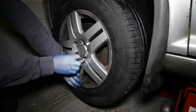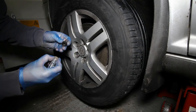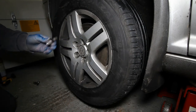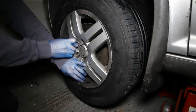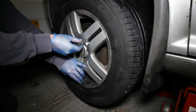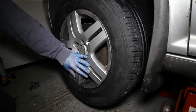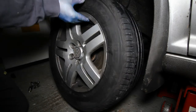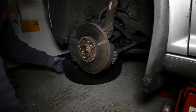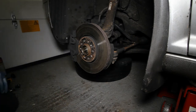Take the locking wheel nut out first so there's no pressure on that. As you can see they're slightly different type of bolts and not as strong as a normal one — put the wheel nut and the lock together. The wheel should be loose enough now, so hold it in place so it doesn't just fall on the floor. There we are, the wheel's off. What I always do is put the wheel under there, under the side I'm working on. The axle stand's got the car, but if anything fails the jack's got it, and if it really goes belly up the wheel will catch it. The wheel won't be much good after, but at least you are safe.